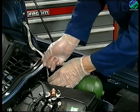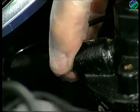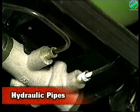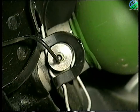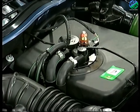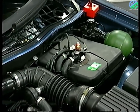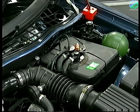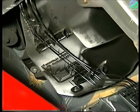Before we look at the source and reserve of pressure, let's start with a few facts about the hydraulic pipes and seals. As we've seen in the previous videos, the pressurised LHM is fed to the various components through steel pipes which have an epoxy coating. This fluid may then be returned to the reservoir via LHM-compatible rubber or plastic pipes, either as an operational return such as that from the power steering, or as a leakage return from components within the system. You may be surprised to know that there is approximately 50 metres of piping on some of our cars.